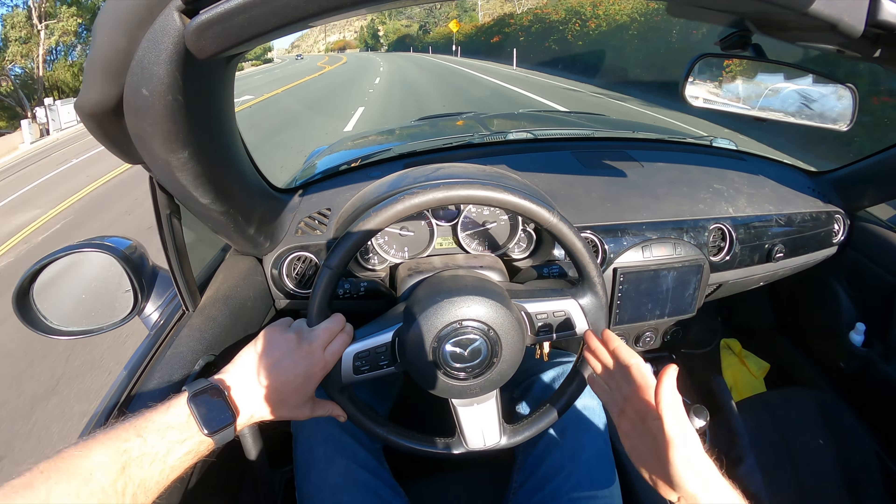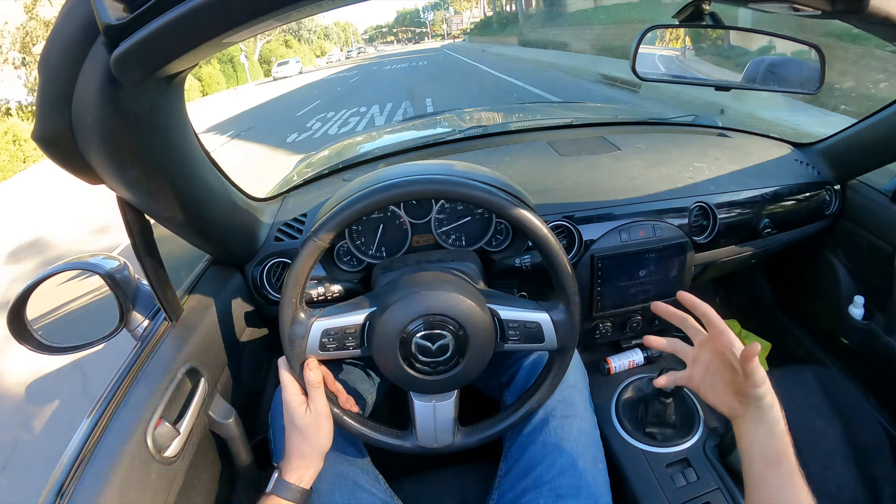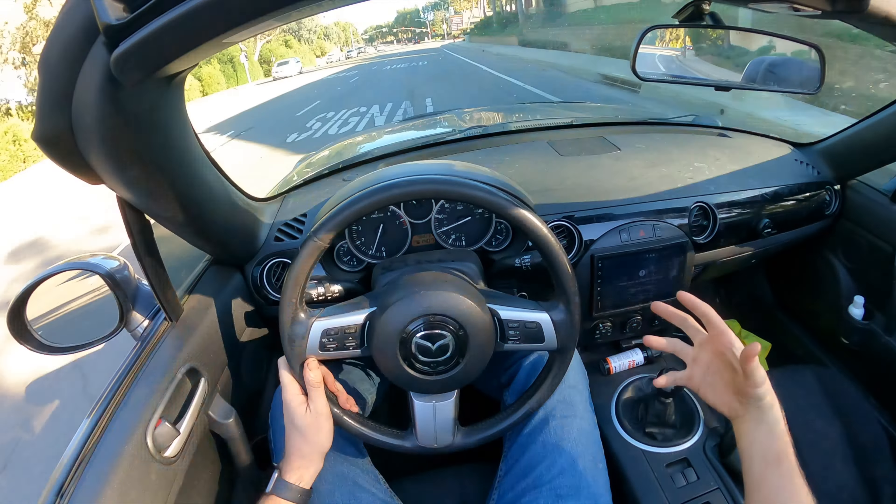When the tires are a little bit cold, like in the morning, I can do some very nice drifts with this differential. It locks up very quick. The other thing I did while I was in here was replace the differential carrier bushings — those were completely shot. I put some polyurethane bushings in there, and now there is no shifter movement. They basically eliminated all of the slop in the transmission.